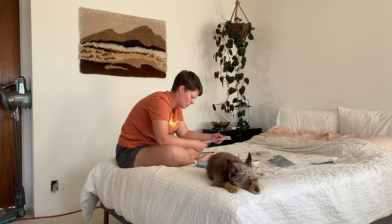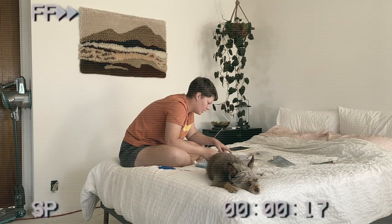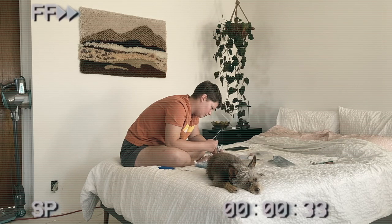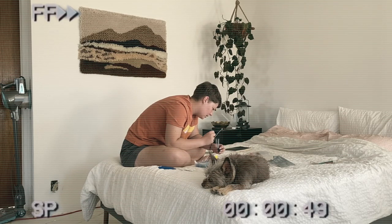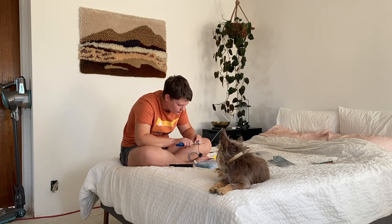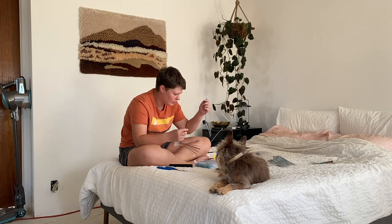So this package is, okay. For, okay, we'll just pick green and black. Green and black is left rear negative, and it's the last one on the A terminal. No, B. Well, A and B are the same, the numbers are the same. So it's position 8. On position 8, the speaker is left rear negative. Left rear, left rear. Yeah, so the colors are going to be color-coded. So I did need that, because these ones are stripped for me already, but these aren't.